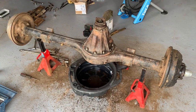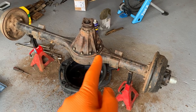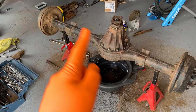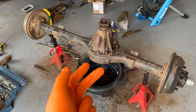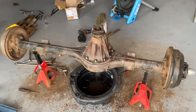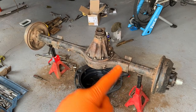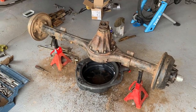Picking up from last time — due to lockdown still going on in the UK, although things are starting to ease, I'm still waiting to get hold of some sealant for the gasket. But I'm quite happy that this has all been nicely degreased, so I'm going to crack on and get the first coat of Hammerite on the back axle. Hammerite is cheap and really tough — you can put it on rough metal like this. It takes a long time to dry and needs two or three coats, so I might as well get started.